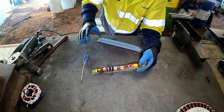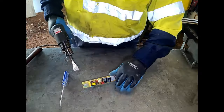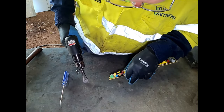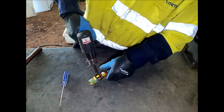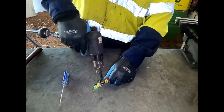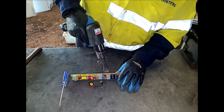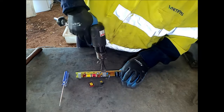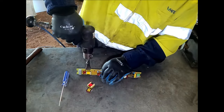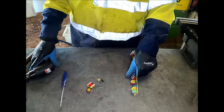But I've got a little technique that goes in straight. Little technique, air chisel. With these, just go straight down. That's why that one didn't work. Okay, we found that out straight away. Straight down the side. Just comes off so easy. There it is there. Same as your extruded. Pops off. It's on the low setting. Done. Oh no, I missed one. Look at that, missed one.